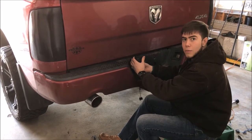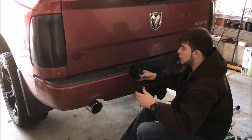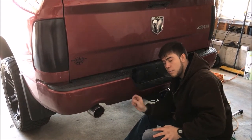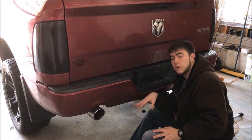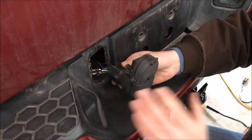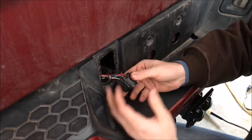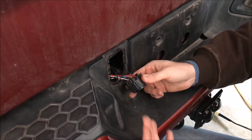Take off the tape from the back of this - exposed here is the solder job I did for the brake light bar. For those who do not have the brake light bar, all you've got to do is take a flat razor blade and skim the plastic coating right off the wiring. I'll show you which wire goes to which, and you're just going to solder right into it like that. Tape it back up, test it out before you put it all together. To remove the big bulky factory connector, it's just two clips on the side and it pops right out.